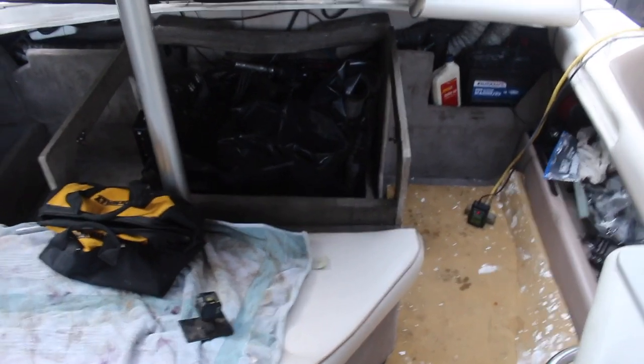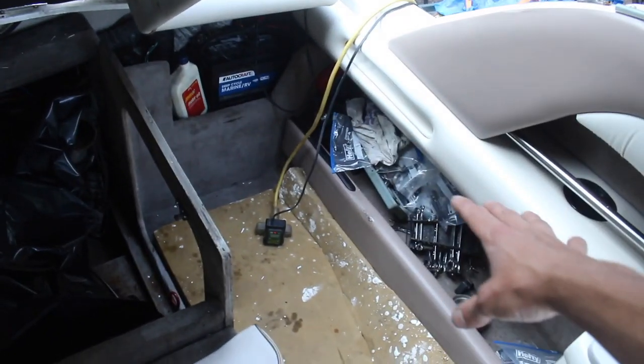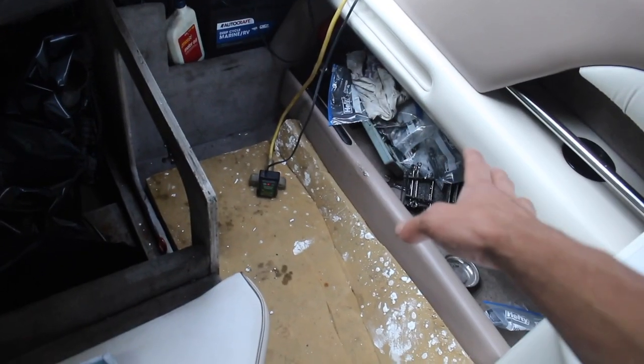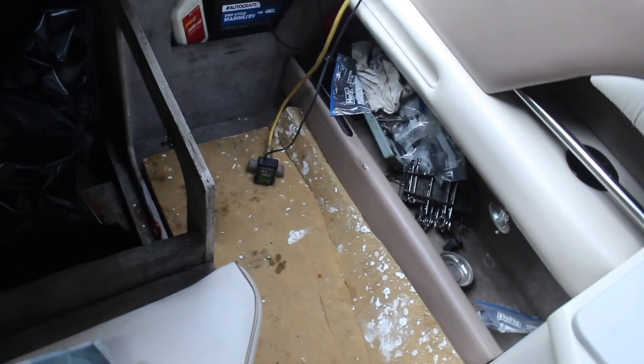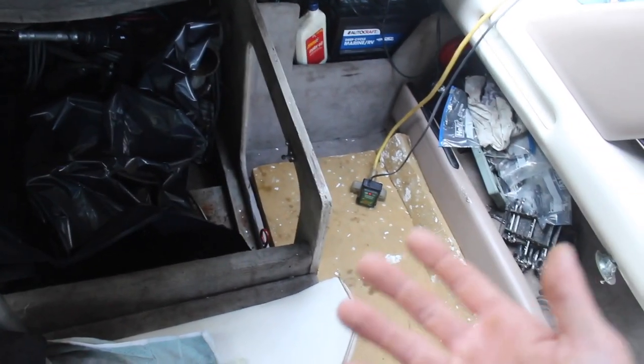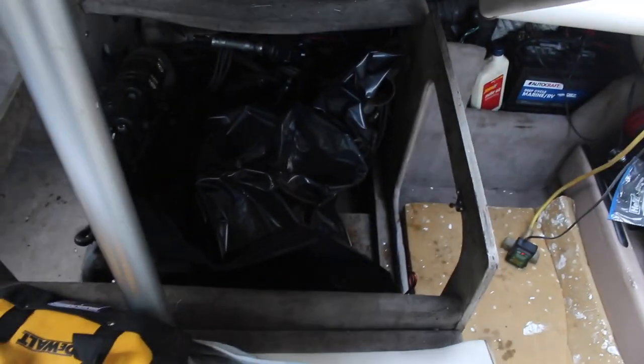All right, I'm back. It's a couple of days later. Gonna work on this engine, gonna get the other head pulled off. I got all my bolts and everything labeled and organized in there, including the push rods, which are bagged with the parts that correspond to that particular cam. And I labeled the head as well. Plus I have it on video, but it's too dark, so I apologize for the GoPro footage. I'm gonna try to get a light in here to do this other side.